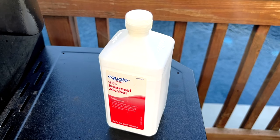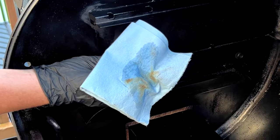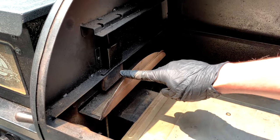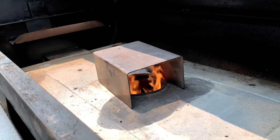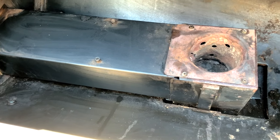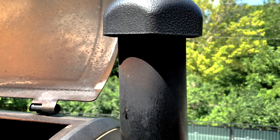Just pour some isopropyl alcohol on a paper towel and give the temperature probe a good rub down to get any built-up grease off of it. Cleaning the temperature probe is one of the best ways to avoid having temperature control issues when cooking with your Pit Boss. We did make an entire video on how to fix two of the other most common temperature problems you'll run into on a Pit Boss — make sure to check that out if you're running into issues. Next rinse off the citrus degreaser with some wet shop towels and then dry everything off really well. If you have some rusty areas on your Pit Boss now is a great time to take care of them — for instance we had some rust buildup on the inside of our lid as well as the top of our exhaust chimney.